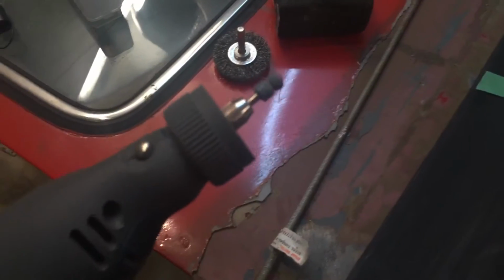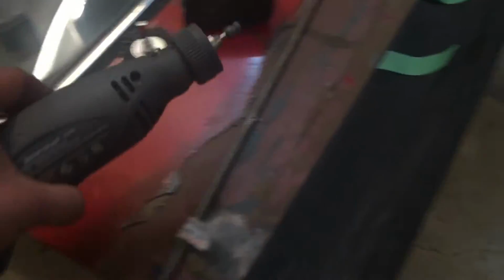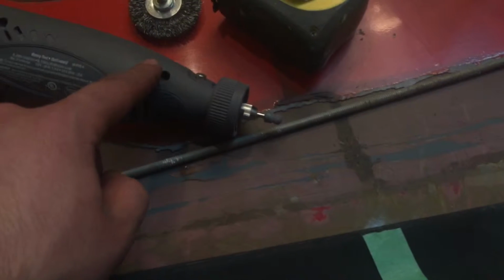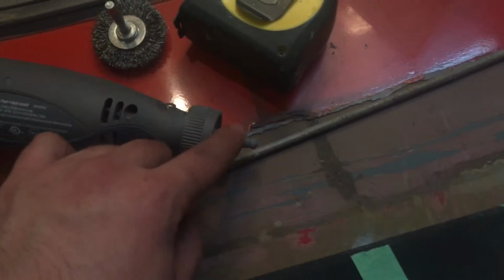Before I do go, I just wanted to give you guys a quick explanation of how I took care of the gasket, which the best way I found was to use a Dremel to grind out the hole. So what you do is you find out where you need the hole, drill a quick hole in it, and then Dremel out the rest of it. So drill a much smaller hole than you need and use the Dremel because it will give you a much smoother overall finish and probably give your gasket less chance of leaking.